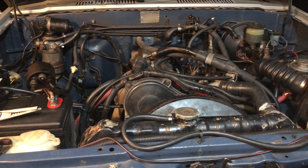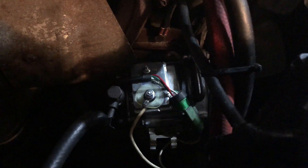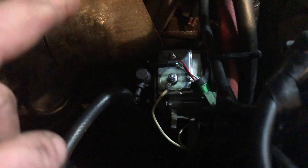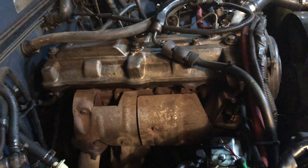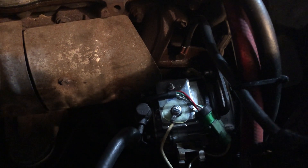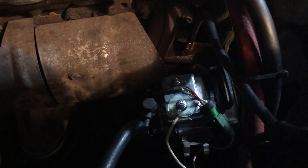It's a five-speed manual, mechanical four-wheel drive, and I can fix almost anything myself that I can get parts for. I have mechanics at work who help me find issues and give ideas. It was up all winter but I couldn't do anything because the alternator was fried. These alternators are a little specific because there's a vacuum pump on the back of the alternator. Of course it gets driven by a belt, but there's also a shaft at the back that runs a vacuum system which actually runs the brake system in these trucks. Diesel engines, especially old ones, definitely don't make any vacuum, so they attached it to the alternator. I was able to find this alternator on RockAuto — I had to look up an early to mid-80s Toyota two-wheel drive with this diesel, but the parts are all interchangeable.